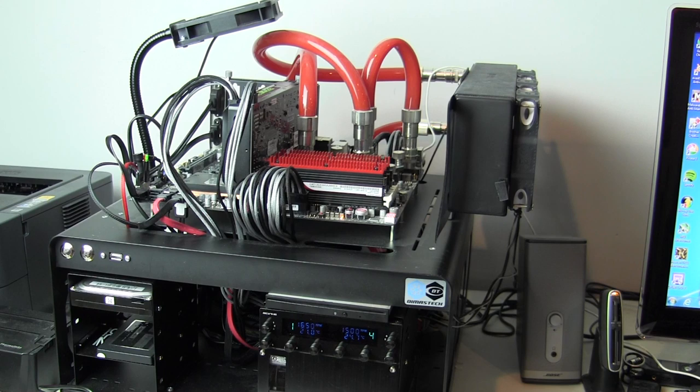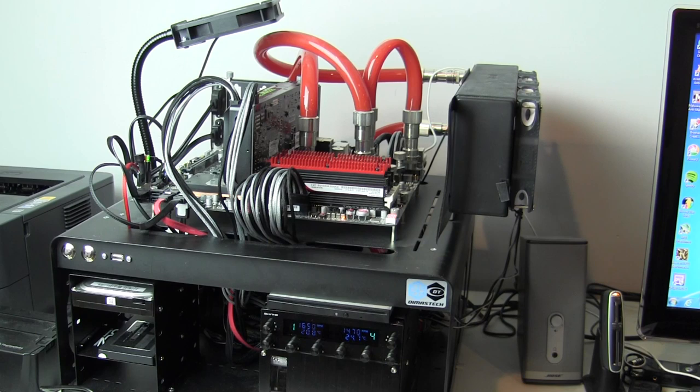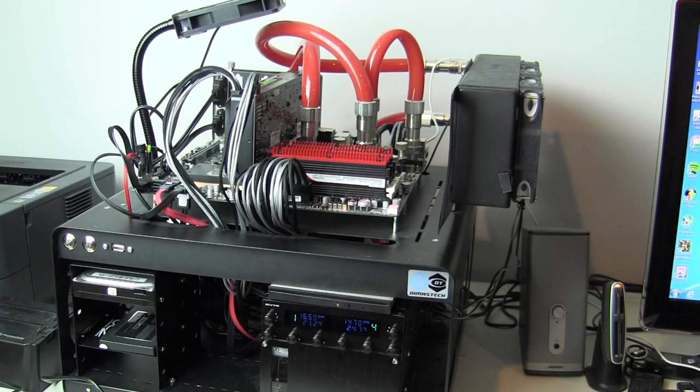Currently that radiator is set up for testing three fans, which I prefer — testing a suite of fans of the same type to show cooling. I also recently received the XSPC CRX 120 for low speed single fan testing, and a GTX 120 Extreme for high speed fans. I prefer primarily to have three fans to test on the 360 rad setup because I believe it's a fairer, more accurate representation.